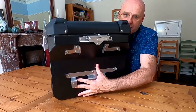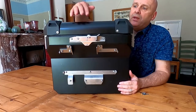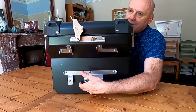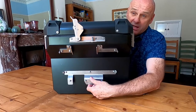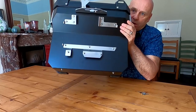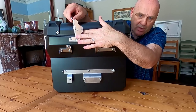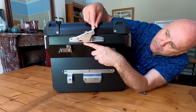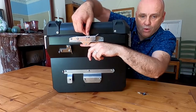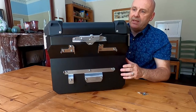Turning the box around so you can see the fitting: this is the right-hand one with the exhaust cutaway. Here's the locking mechanism at the top — unlocked at the moment. Down here there's what's probably aluminium or stainless, very robust. You would tip the box away from the bike, drop the bottom lug onto the base of the scaffolding, run the top onto the scaffolding rail, bring this locking bar down over it, lock it with the key, and the box is then secured to the unit.